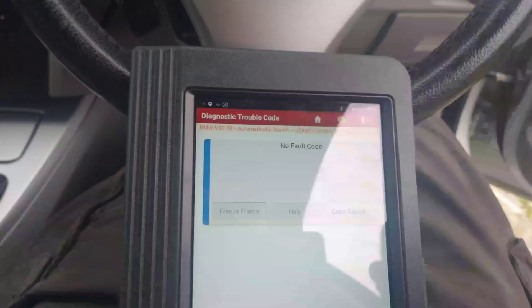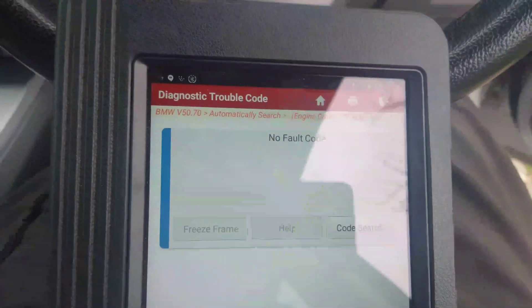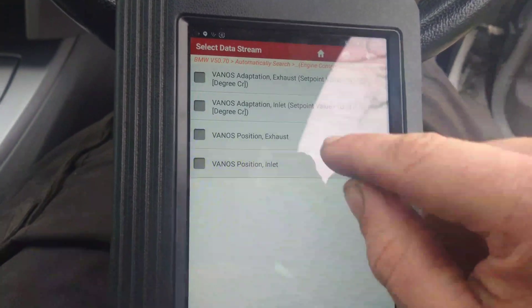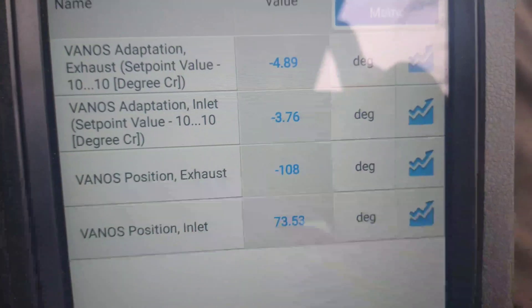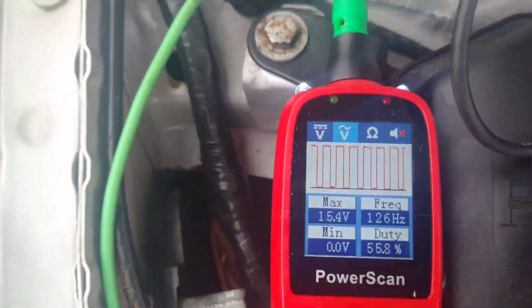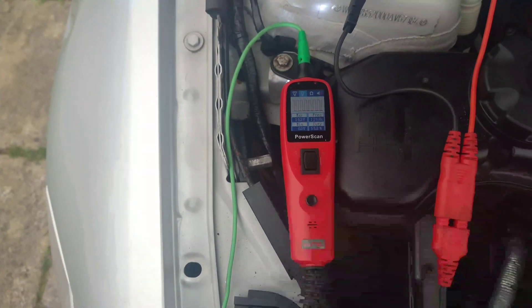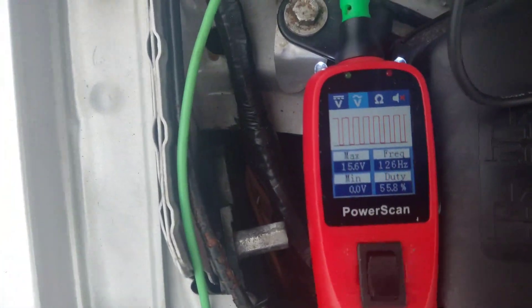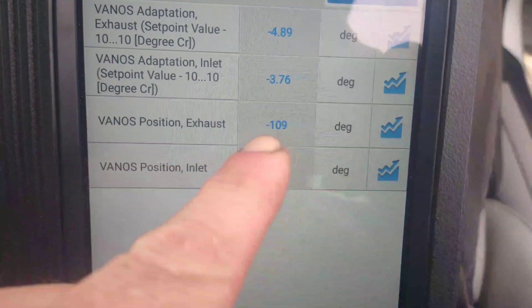Let's see if it's working. No fault codes - the engine is running. Let's look at the data stream to see if there's any change. That's changed - it's minus 18 and it's moving now, so we have got a change going on. Looking at the front - I've got a different pattern. The duty cycle's almost 50% and before it was much different - it wasn't 50% anyway. So now it's working, the duty cycle's changed as well. It looks like it's happy because that's changing and it wouldn't change before.